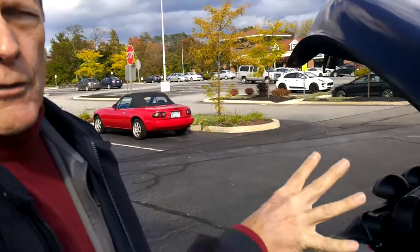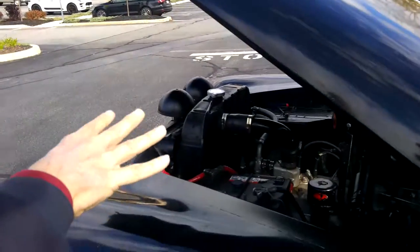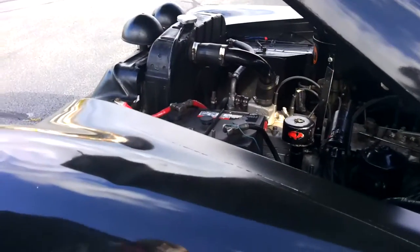Why do they have the valves in the side? It's easier — the engines are easier to build, have fewer moving parts, and they're quieter. An overhead valve engine makes more noise; you can hear the valve train. On these, when they're tuned up properly, you can't even hear them run. The valves are harder to adjust here than on an overhead, but everything else is generally more accessible.